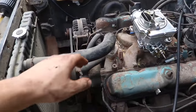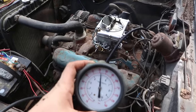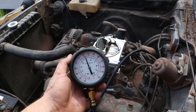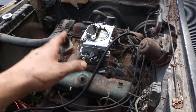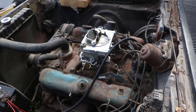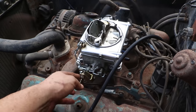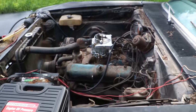We're up to operating temperature, the thermostat has officially opened. But look - we're still getting 70 PSI, just a smidge above. It could be some pretty thick oil, but that's still good. If we run a 10-30 or 10-40, I think we'd have really good oil pressure. The oil is hot, it's circulating properly, and it's running at a very consistent oil pressure. It's not dropping when we rev it - it actually increases. So that tells me this thing isn't really messed up. I think that's a proper candidate for the 58.